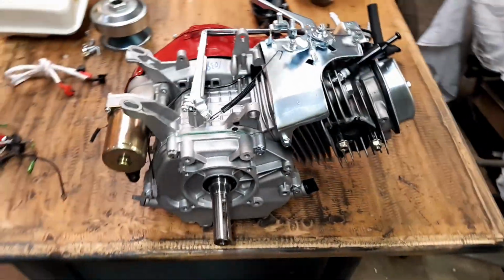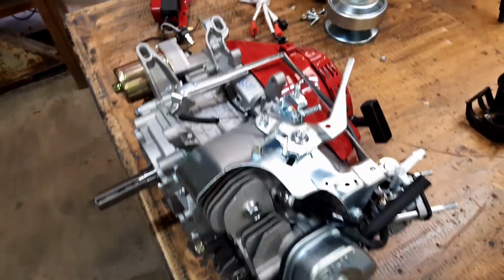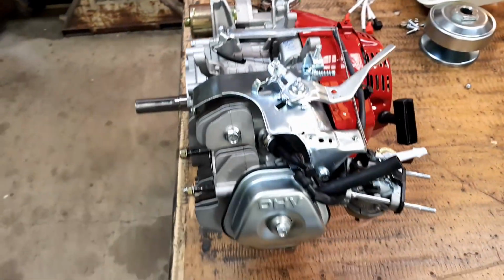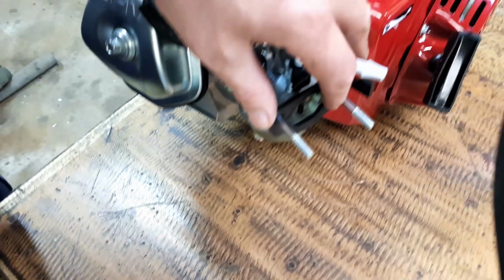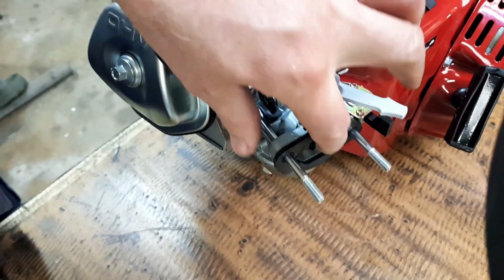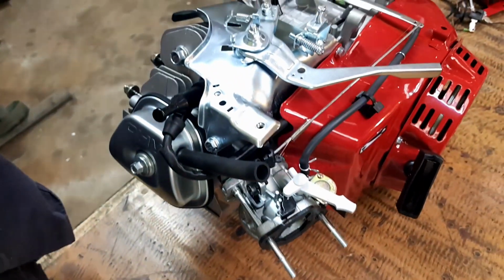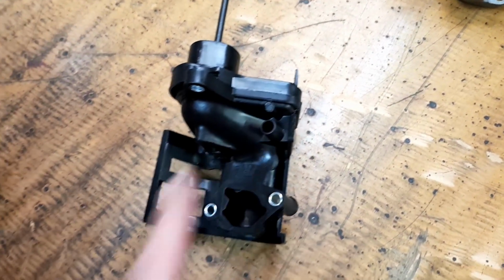once it's in the buggy itself. So a little bit of... looks a bit bare, but it shouldn't be too much trouble. I'll just put a couple of rags and put the nuts over these so the carburetor doesn't come off, because it just slips on there at the moment. And block up the holes. Like this one is just a breather that goes back into the air filter box. Like there's the breather port there.